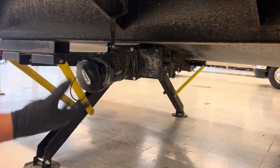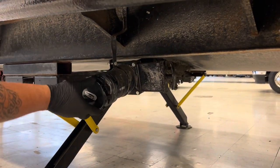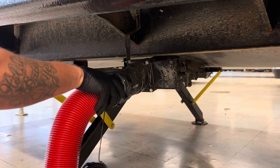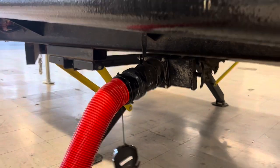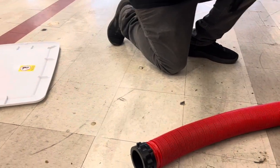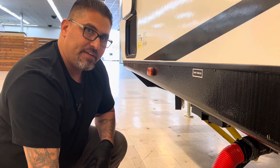Twist the cap off — it may be a little tight, you may need two hands. Take this end of the hose and connect it. Stretch the hose out. Remember, if you have a full hookup campground and you are hooking up your sewer lines, make sure the hole where the lines go in is right between the coach so the hoses can reach. Now that we've hooked up this gray water line, we'll leave it and go hook up the other hose in the rear.